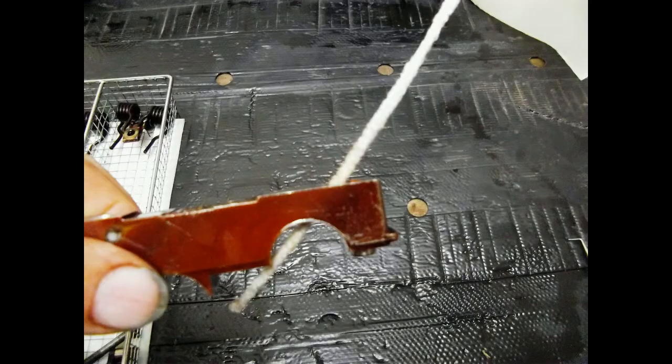And yes, like I expected, there are pieces of liquid gasket in this unit as well. I really hope the pea brain who worked on this engine only was trusted this one. Just imagine he did a few more and lost whatever foreign objects in it. Cleaning out the oil channels. They are dirty inside and I want to be absolutely sure there is no more gunk in it or stuff that does not belong there. Takes some more time but better safe than sorry.